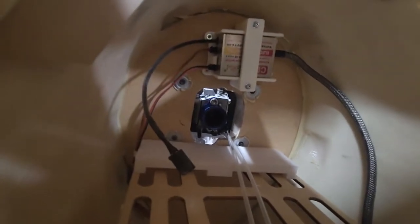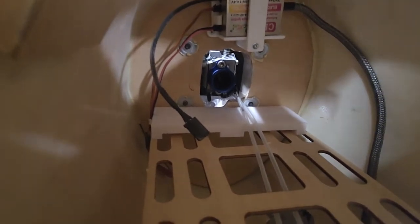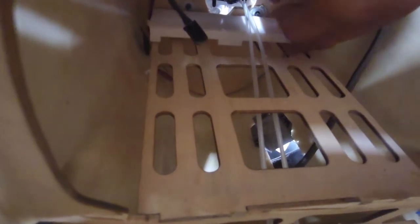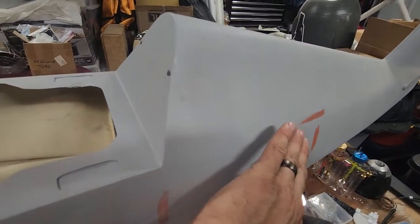I found a good spot for the CDI up front, but with the removal and modification of the firewall that's all going to get pulled out. I'll probably laser cut a different, stronger plate and reevaluate — still likely going to go with the skid mount, but push it back a little, which means moving some things around. That'll also allow me to get down in there and access those scale exhaust sections. I'll come back and reinforce the interior as well, building a system with a couple of elevated servos to mount my wastegates.